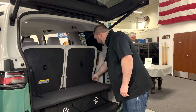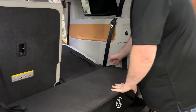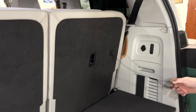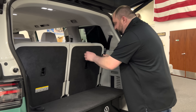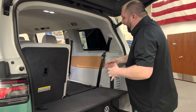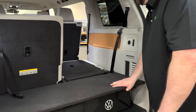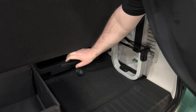This seat has something else I really don't like. If I want to fold the seat down I use this little tiny strap — pull it up and I can fold down the seat. But this strap is only for lifting the seat up; it doesn't actually function the lock. I have to pull the lock then pull the seat up. We've seen in other vehicles reviewed that with a third row this strap would connect to the latch so you can just pull it to release. On this one the strap is completely only for lifting. I understand why they designed it this way — it's a fairly inexpensive strap — but if that strap breaks I can no longer grab it to fold that seat up. In order to remove the seat there's another cable here, and I can lift that whole seat right out of the vehicle.